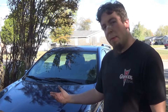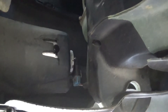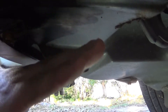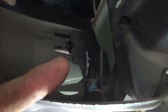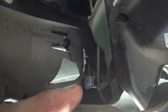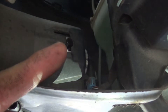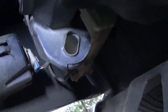These should fit in the stock location with no modifications and just plug straight into the existing wiring harness. The fog lights are in the bumper — you can scroll up underneath and remove the old ones. The easiest thing to do here is to remove this screw and this screw, then pull back the splash guard a little bit and out of the way so we can get to removing the fog light assembly.